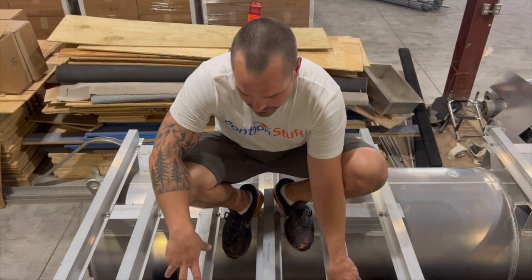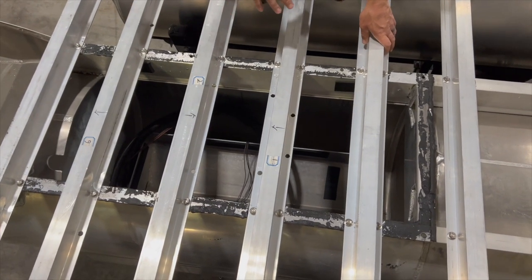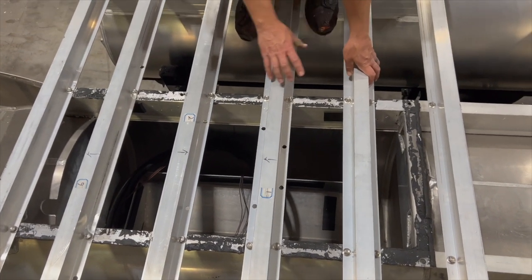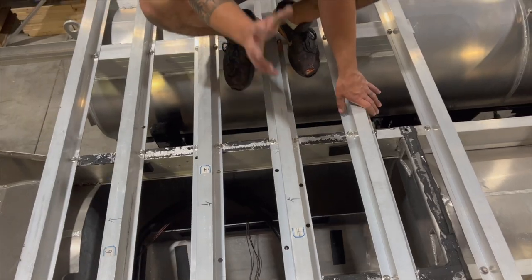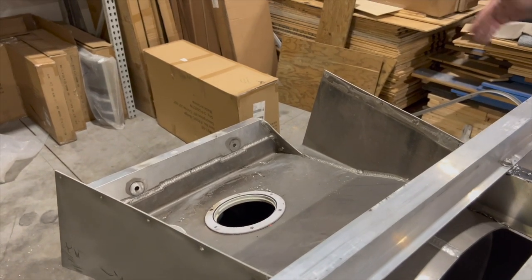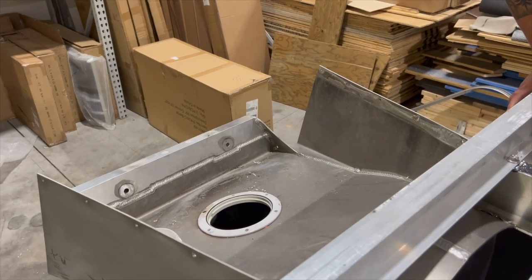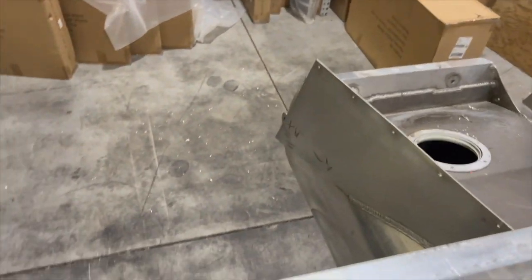This back portion was created for a gas tank — you'll sometimes see ski lockers or gas tank compartments here. What we want to do is waterproof this so it's a dry compartment. We'll do an underskinning to keep it watertight; that airtight space gives us more buoyancy for the big heavy 200-horse motor. One last thing: our motor pod sticks back pretty far — the outer pontoon is 22 feet and the center pontoon here is 24 feet.